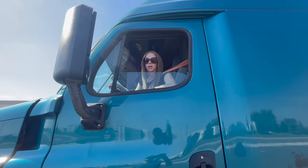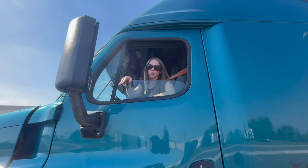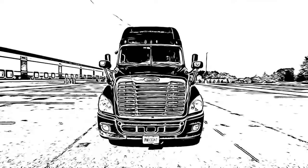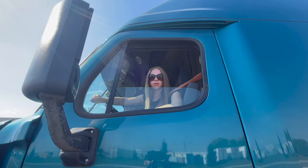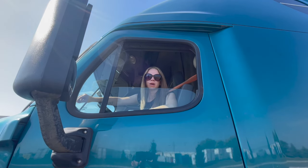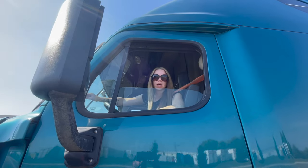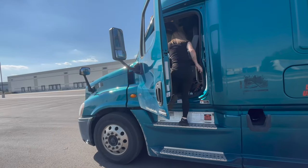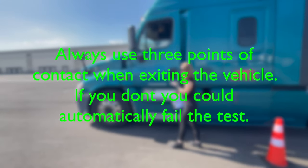For the side of the vehicle, I will have you inspect the side of the vehicle and the side of the trailer. There will be my left turn signal, my right turn signal, my four-ways, and my marker lights. First I'll have you inspect the rear driver's side of the trailer to check that the ABS light goes on and turns off, indicating there's nothing wrong with the ABS. Then I will have you inspect the rear of the trailer, which will be my left turn signal, my right turn signal, my four-ways, my brake lights, and my tail lights.